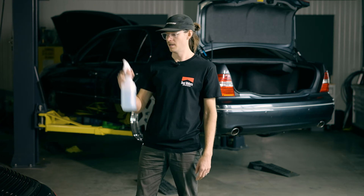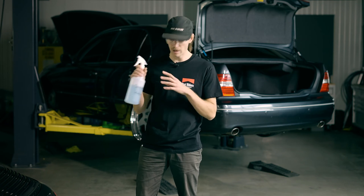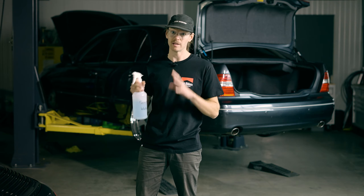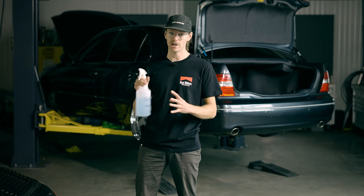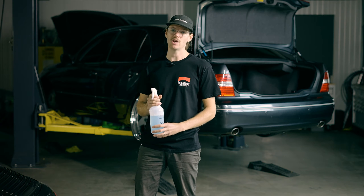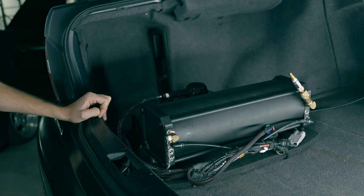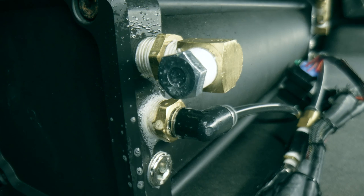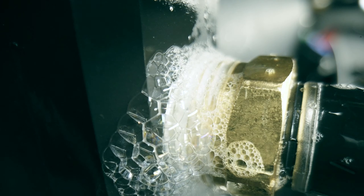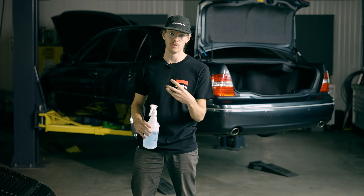Let's test for a management leak first. I've mixed up some soapy water in a clean spray bottle. Since I'm right now just looking for a management related issue, I only need to check in one place. I'm going to be in the trunk of my vehicle and check each and every fitting that goes into the tank, regardless of what it does. Found the leak — see these bubbles that just keep on growing? That's a sign that a small amount of air is leaking into that soap and creating those bubbles.